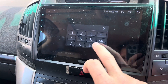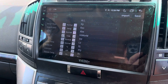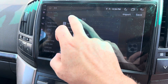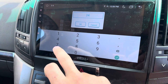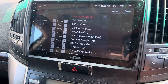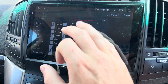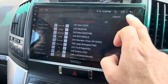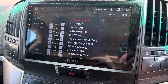To change it, come up to Settings, enter the code 8878, press OK, then select CAN Type. These are all the different profiles listed here — we'll normally just give you a number. For example, 240 is a VW number for a certain CAN profile. Once you've chosen that, click Save up here and it's going to reboot and save.